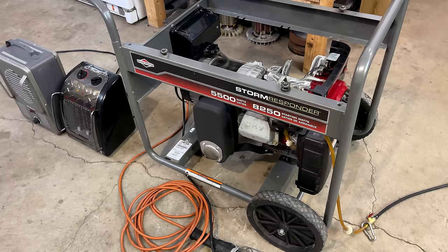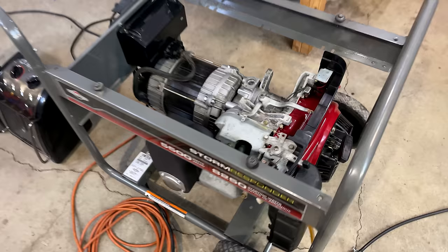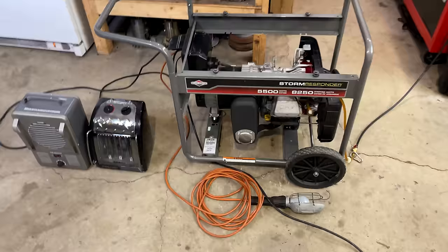Anyway, more importantly, we have output. That light came right on. I bumped the throttle to bring the engine speed up, and overshot a bit to 63.5 hertz, so we'll fine tune that later. The voltage was also high at 136 volts.